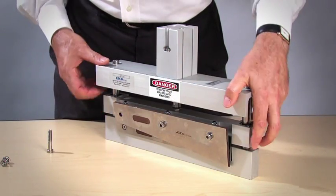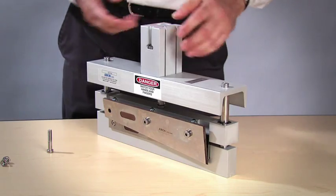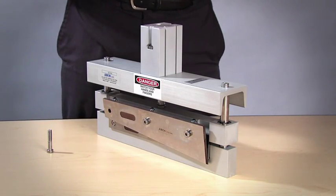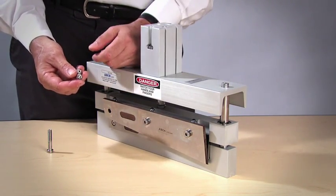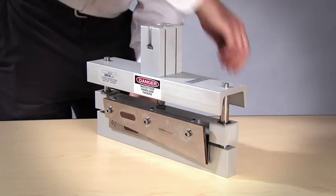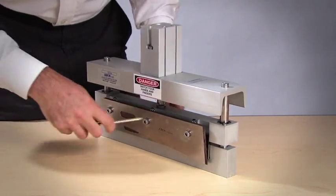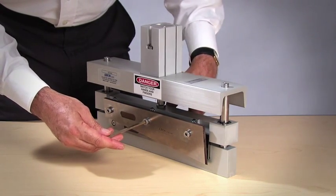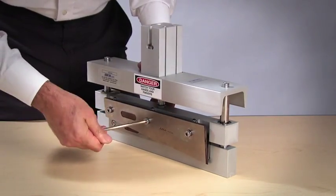The first thing you do in order to set a knife assembly and blades is you have to be absolutely sure that there's nothing connected to the unit for safety. The blade is now just being held on by these two screws, and I also always recommend that you replace the locking nuts. The locking nuts are anti-vibration devices built in that keep the screws from vibrating loose. The nuts on the back are captured, so you don't need a wrench — it actually holds itself from spinning. It also makes it so that the knife is a lower profile and doesn't take as much space.